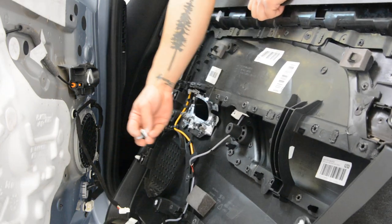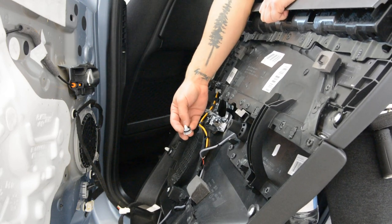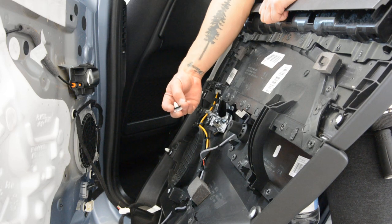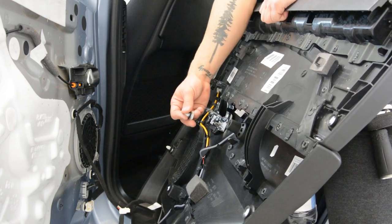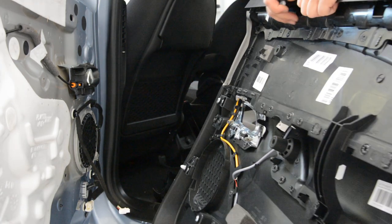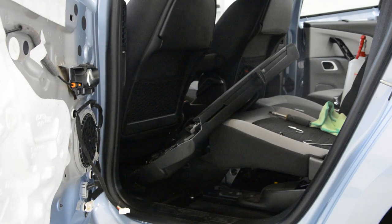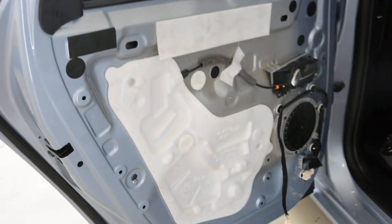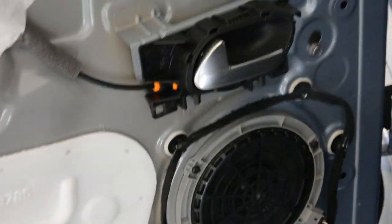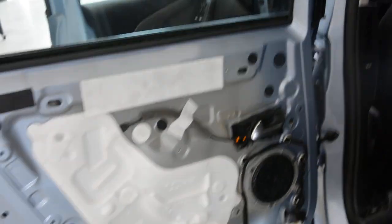Order replacements when you have to remove the door panels — be prepared for this type of thing, because this is a Citroen, it is not a Mercedes, and the materials are not so good. This is how you remove the door panel from your Citroen C4 2013. Here is your speaker — three screws, T25 or T20. Thank you for watching, have a nice day, bye bye.